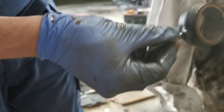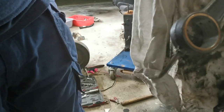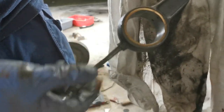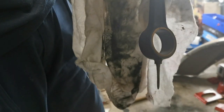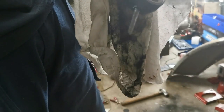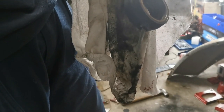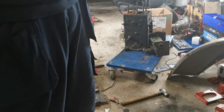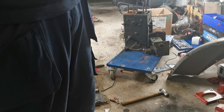The little spike on the bottom is your oil pump, funnily enough. It literally just splashes oil around the crankcase and just sprays it up all over the place. And it just creates a mist of oil inside there, which is how everything stays oily. There's no oil pump in this engine, really. I mean, that's it. It's not an oil pump. It's called an oil splasher. Scientific name, you know. They really pushed the boat out when they came up with that one.